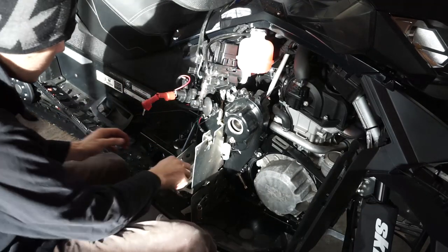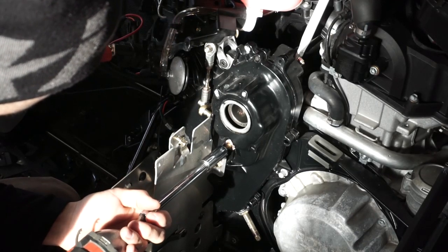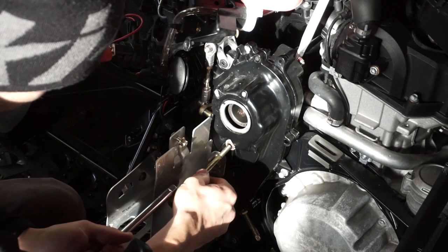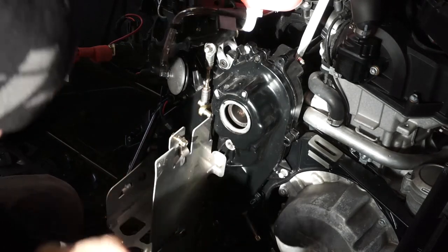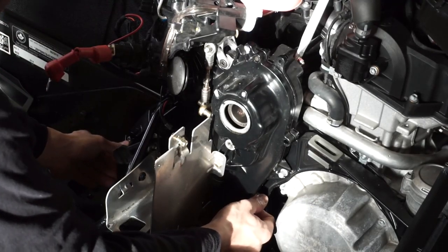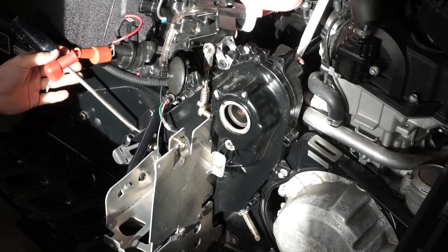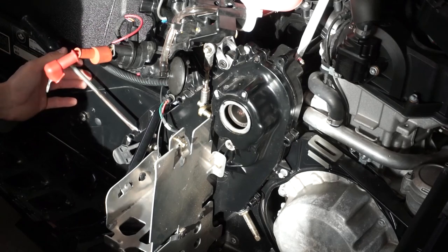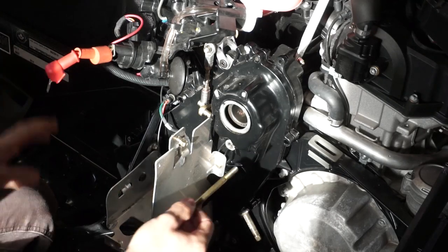There you go. Just take this one bolt off. There's a little copper washer there — don't lose that, whatever you do. Now it's a bit looser on the bottom. I just cracked it open just a bit to get the excess oil out. Alright guys, all the oil is drained out. I let it drip for about 10 minutes, just to be safe.